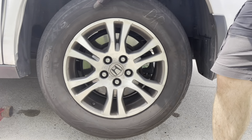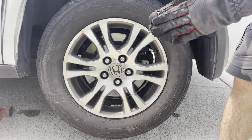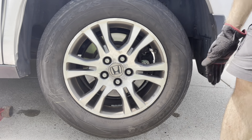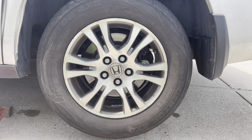Of course you hear it, it's because the brakes are touching, but once the car is running, it will open those pads, because the pads have to be very close to the rotor. So when you apply the brakes, it puts that pressure. But this is a good to go wheel now. I'm gonna do the brakes on all the other three wheels just to renew them, because I think these ones are like 2 years old, more than half worn. So it's time.